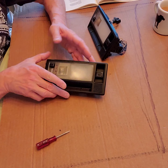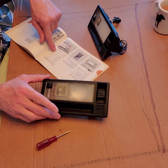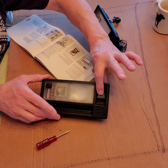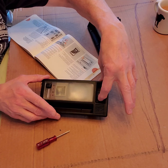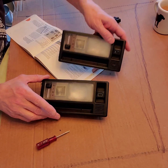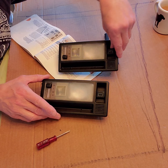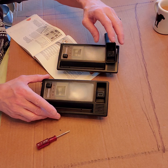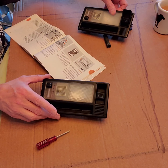So this is the moonroof control. I have the original instruction manual. Pushing the switch in raises the rear moonroof. Pulling it up lowers the rear moonroof. Taking it to the top direction slides the roof open, and this closes the roof. Now the second dome light I've got has a broken button, so it looks a bit crappy, but the mechanism seems to be okay. I've already pulled that previously — all the tabs broke off — but I wanted to include it. That's why I got the second one. I might have to cannibalize from one to the other, and that is a total car guy thing.